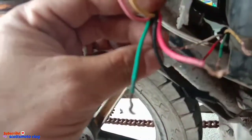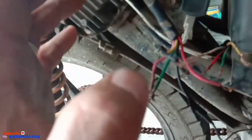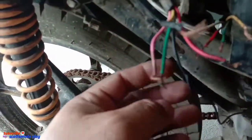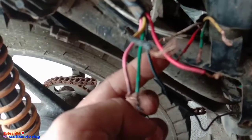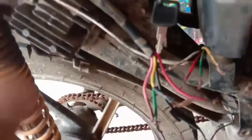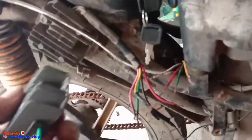Okay. Our new rectifier regulator — same as the old one — has five wires. That one wire goes to the ACC wire. It's not connected to the red wire going to the battery — it needs to get supply only when our switch is turned on.